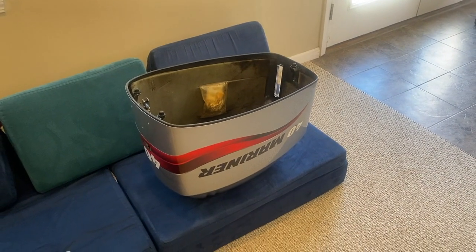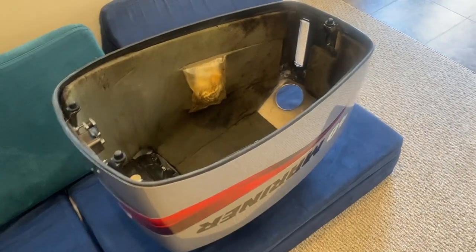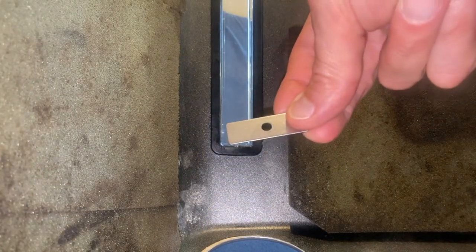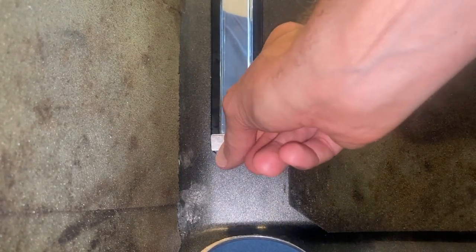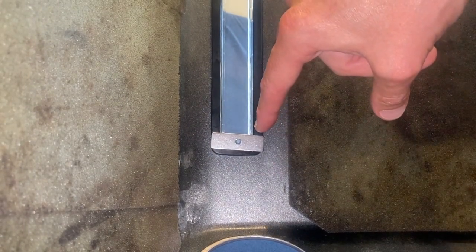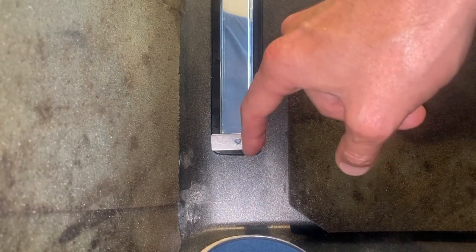We've made our way to a location where I feel comfortable setting the cowl on. Last thing we want to do is scratch it. Coming inside. Camera in position and grabbing the small aluminum plate here. And each side is the same. Just slide that on. As you see here, on the acrylic lens itself, you've got two little tabs, one on each side. Make sure the aluminum plate is underneath each of those tabs.